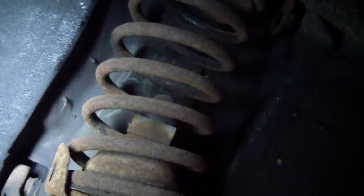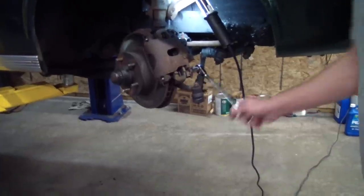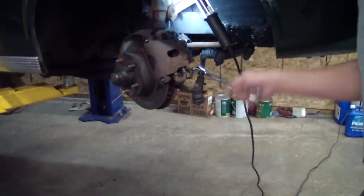It's kind of a bonus on these — there's actually a bearing in here, so no upper ball joint to fail. We're going to put this lower arm under some preload and take the shock out and see how loose that spring becomes. Before I do anything, I'm going to take off this caliper and hang it with a piece of wire.